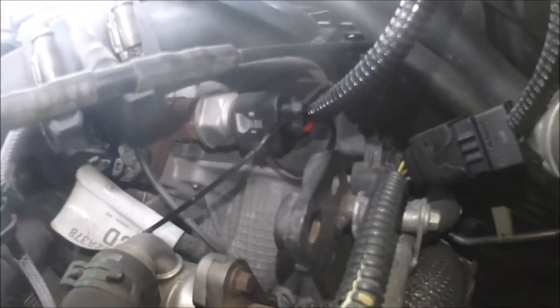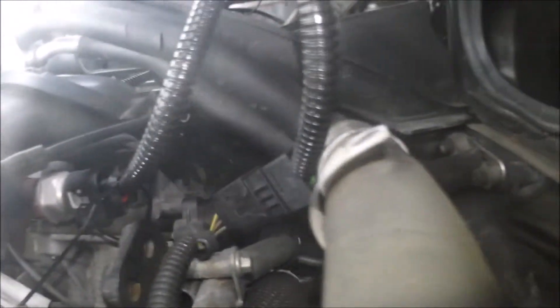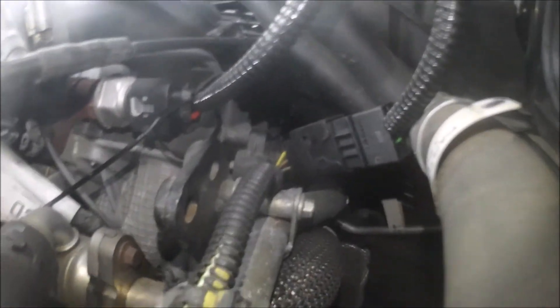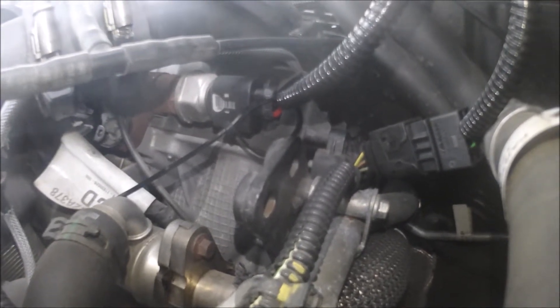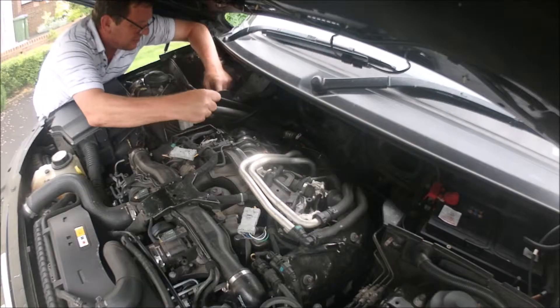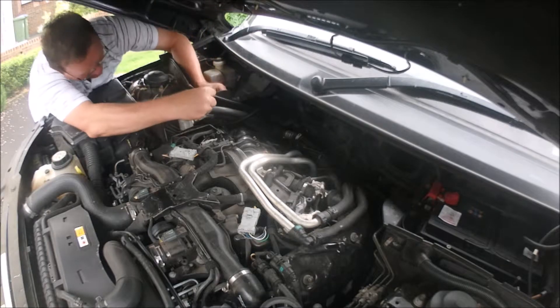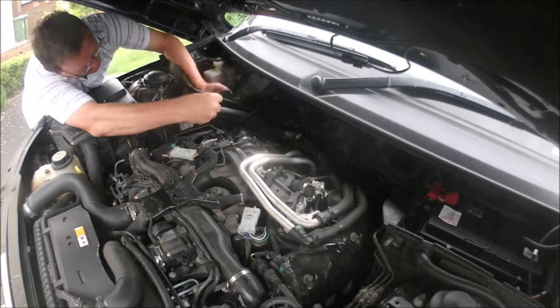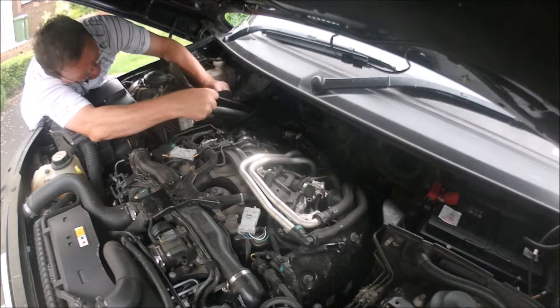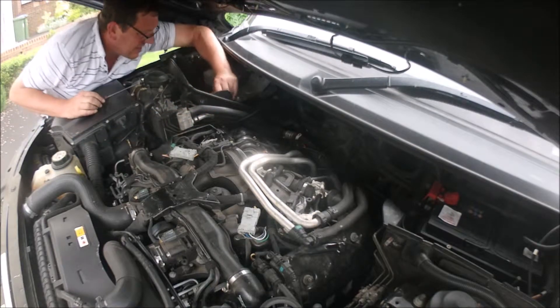From this angle you can see the wiring loom. The yellow wires on the original were unplugged from where that little red wire is now plugged in. The Land Rover original is plugged into the new wiring loom, and the new wiring loom is plugged into the engine as a replacement. Fiddly but possible. I then push the wire through the rubber grommet into the corner of the engine bay — a nice safe, clean area away from all the heat and dirt, so the chip itself is kept clean, safe, and dry.